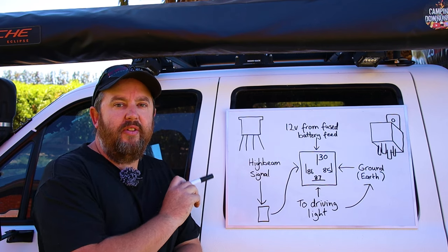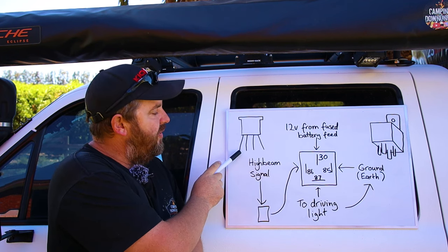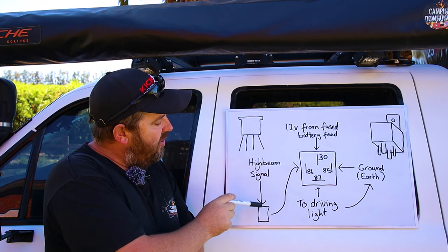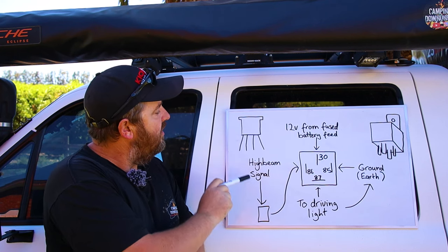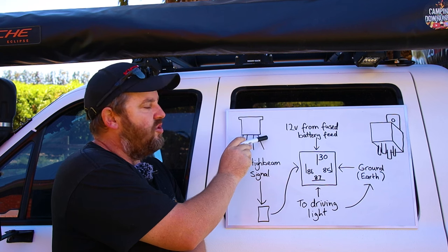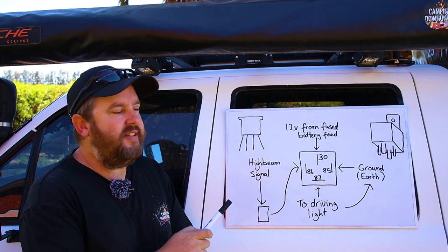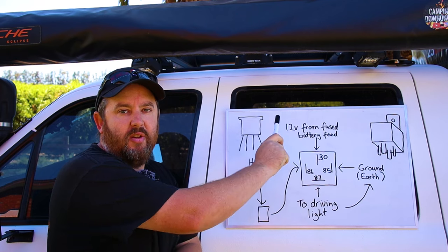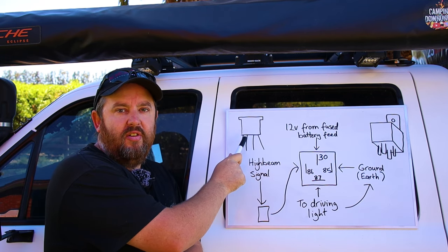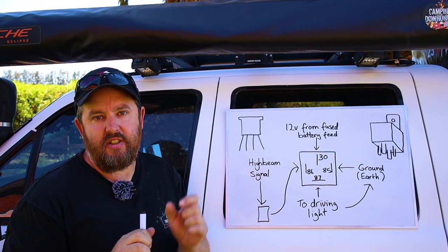How the switch works inside your car: the majority of blanking plug switches now look nice and fill up that blanking hole really neatly. There are four wires on each one. You have your power in — coming straight from your high beam signal — and then the next one is your power out, which goes from your switch back to your relay. Then you have your illumination wire that lights up your switch — that's optional. And then you have an earth next to it, also optional, which you only use if you want to illuminate the switch. To find the illumination wire, find a switch next to the one you're installing; if it illuminates, test the wires until you find one that lights up when the lights are on. You can just solder that straight into the other illumination wire and it's done.